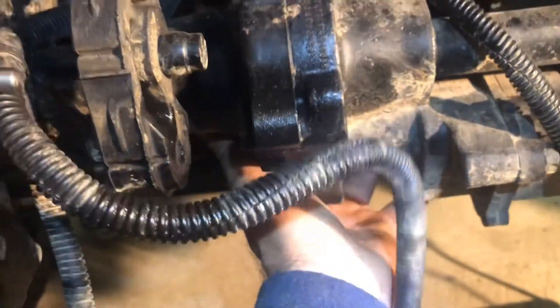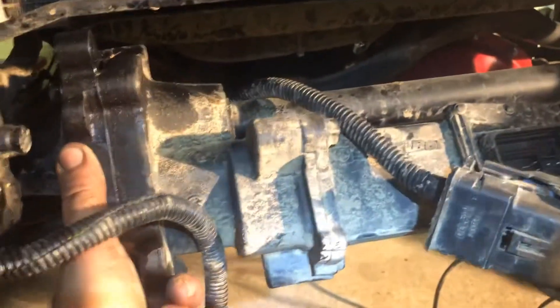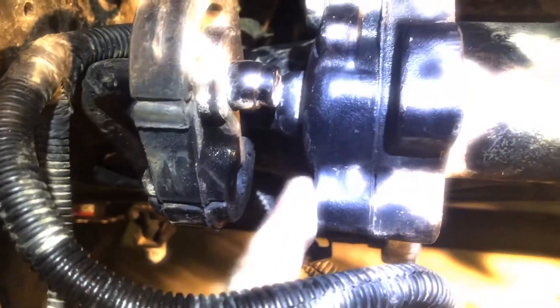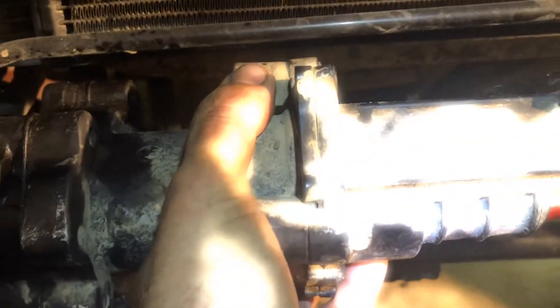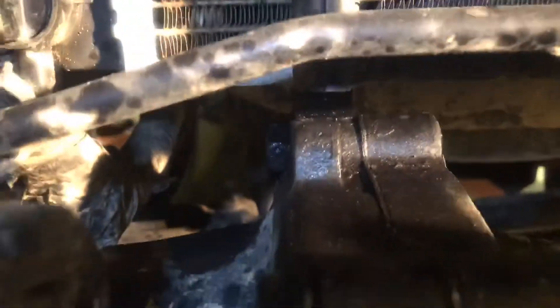Disconnected the sway bar motor here — I just have to get a special bolt, and then this thing ends up rotating up like this. This is kind of interesting — its final location will be right there, so that the new Metal Cloak bolt can go through that hole in that rubber isolator hanger. The second bolt I removed was right here — the first one was on the other side, you remove it and discard it. This whole motor, as you're looking at it sitting at the front driver's side tire and looking straight ahead, you would be rotating it up and clockwise out of the way.